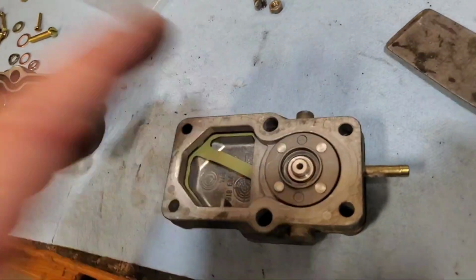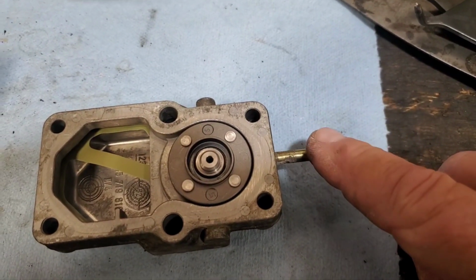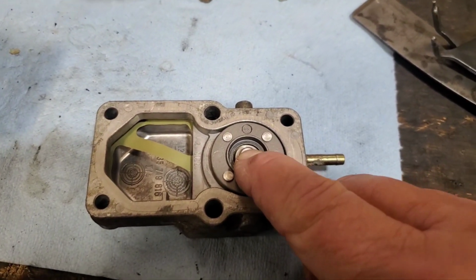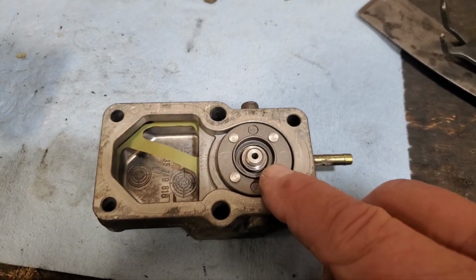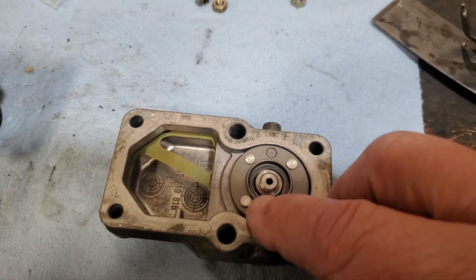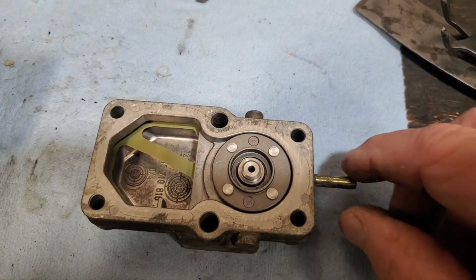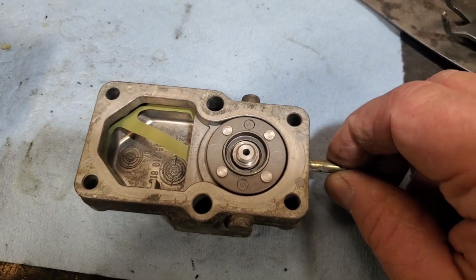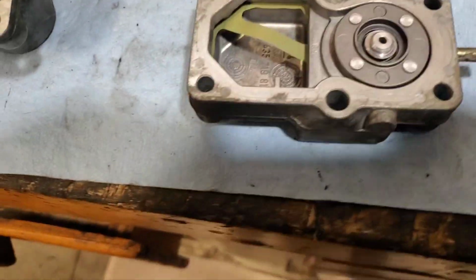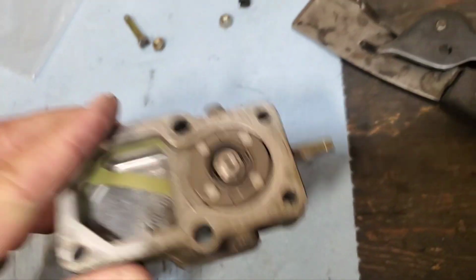Another thing, I tried blowing air into this orifice and pressing on this to affect the diaphragm. Should get a little airflow, I would think, or maybe not. Maybe the vacuum is just helping. That's what it is. You won't get any airflow. I suspect if you put enough vacuum on this, you would actually see this move. I might do that, I've got a vacuum pump. But I don't know that I can change that out anyway. I didn't get the parts for it.